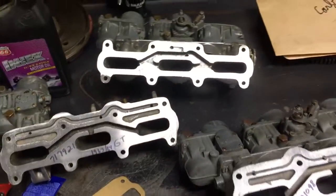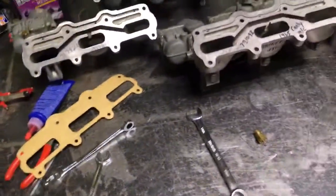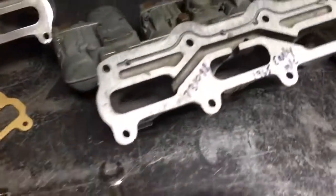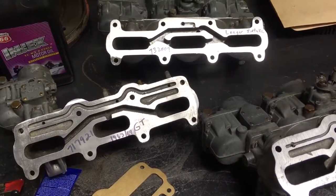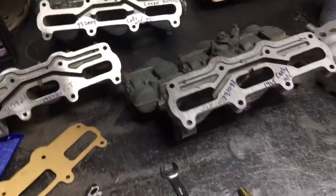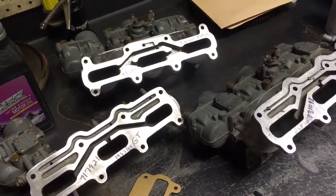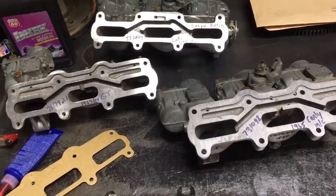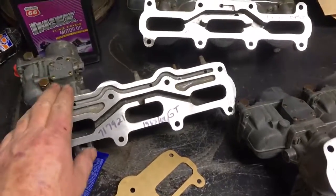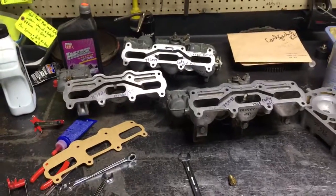I'll do more tests with all these carburetors and get everything out online eventually. But for right now, there are some jets we're using to mix things up. I know the Sonnet setup definitely runs lean, and I know the late Monte Carlo — I just ran it — it runs lean. So again, 15 points higher is what I think is going to be a good number to jet your carburetors. More than I used to do for sure, but the triple pipes really don't lie.